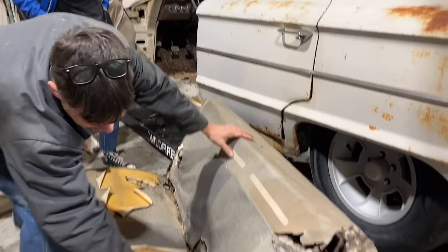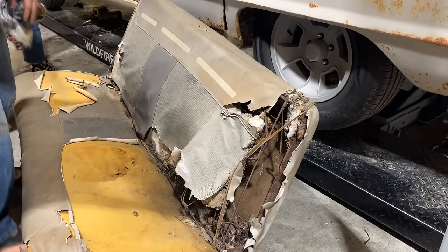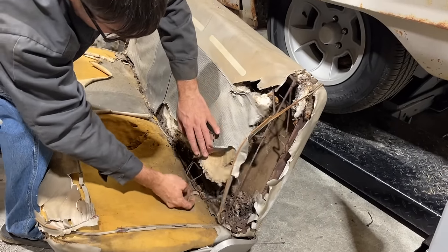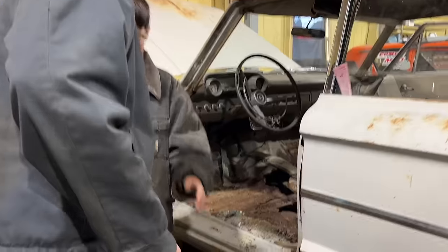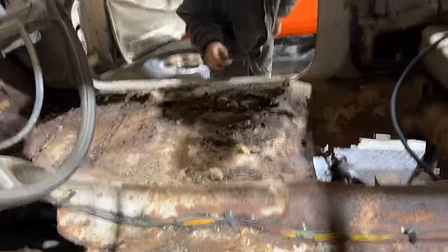Floor go. This is the one that gets me every time. Right there, see, our seat frame itself is actually broke through right there. That's unfortunate. So that's why it hooks you. So we need to really get a hold of the seat frame for the front. We're definitely going to have to have, look, from right there all the way to here. Needs a really good replace.